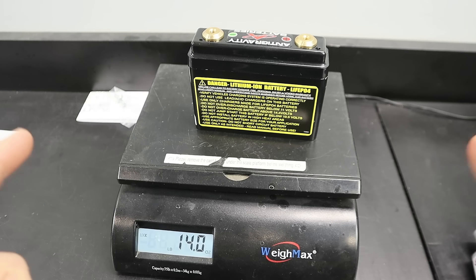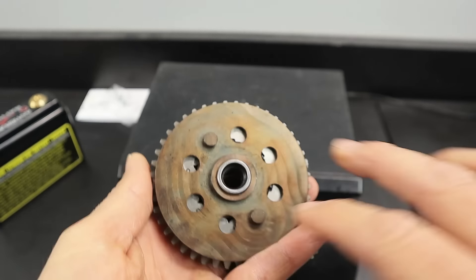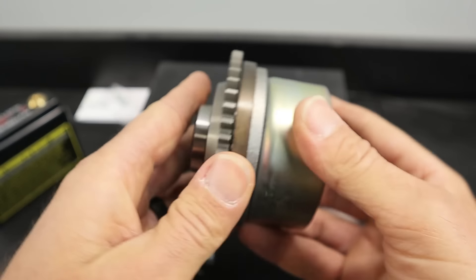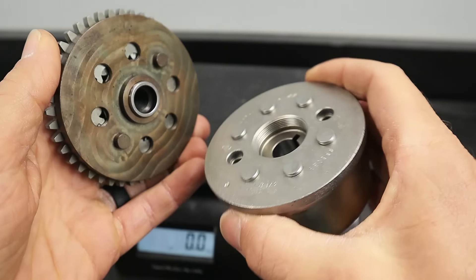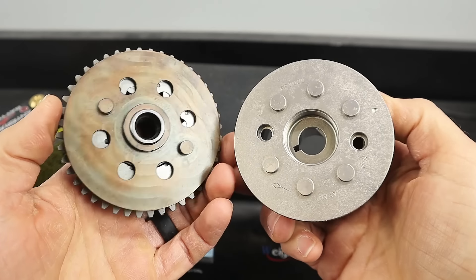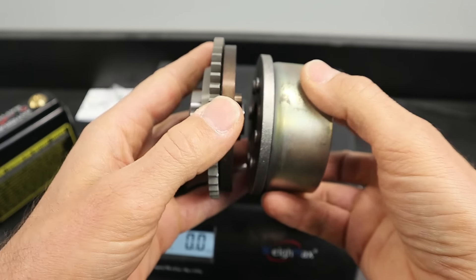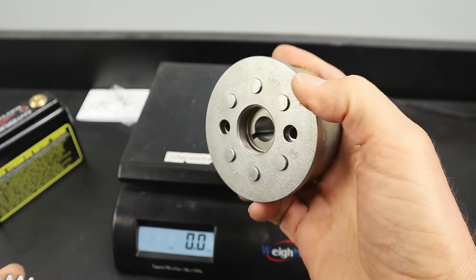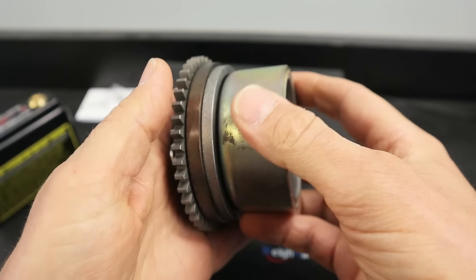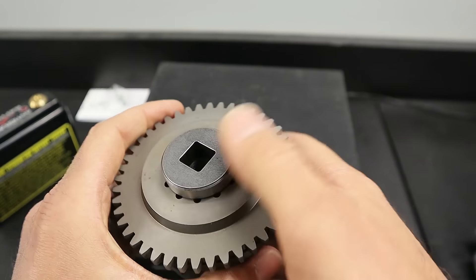I want to bring your attention to this main gear that goes right onto the flywheel, locking via two pins much like a flywheel holder tool. If you're familiar with flywheel weights, basically it's a weight you add to the end of your flywheel to create more inertia as your engine spins — making it easier to start and much harder to stall. A lot of off-road guys prefer a heavier flywheel, maybe 13 ounces being the most I've ever seen. MX guys might go six ounces.